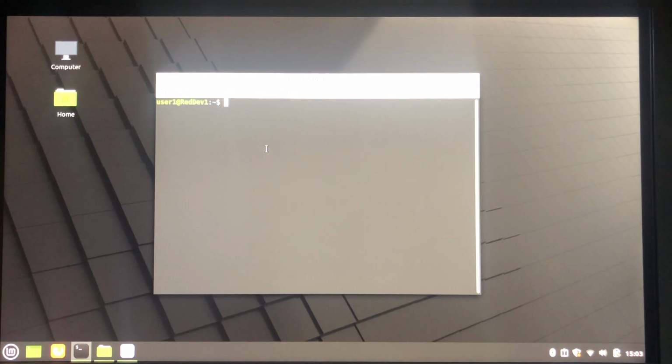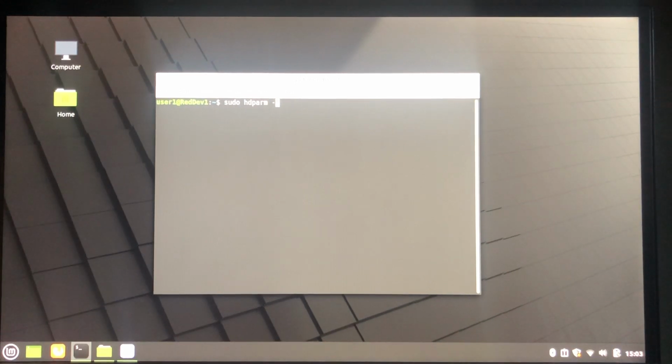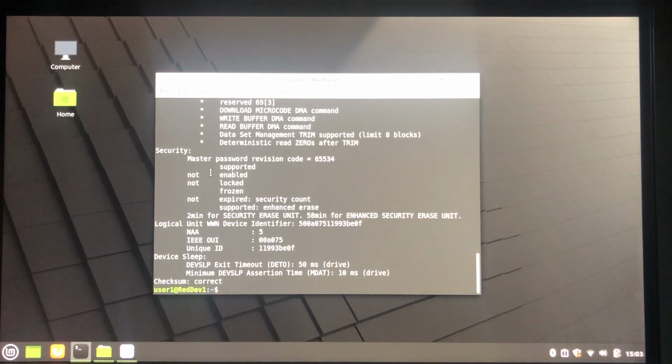So what I did was reboot the system with the disk still plugged in, and it came up, we'll have a look, it came up with the disk frozen, which is normal. Right, we are. So SDB is now frozen, and the way to unfreeze it is to sleep the computer, and we'll do that in this little script.